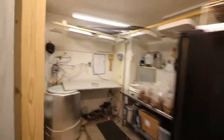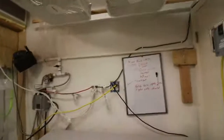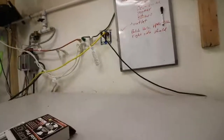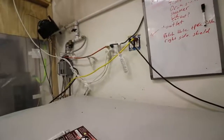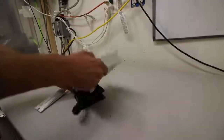One thing is you always want to make sure they're either pointing sideways or down. The reason for that is the cup shape of the actual fan. You want to have them pointing down or sideways, because if you don't, what happens is the water will build up inside of the actual fan housing, and then you're going to have issues with it frying out.